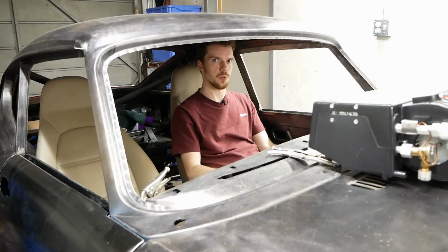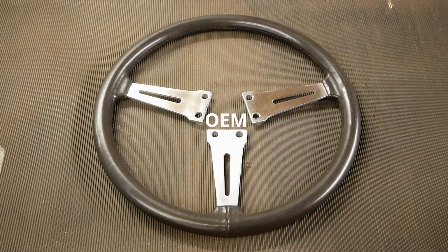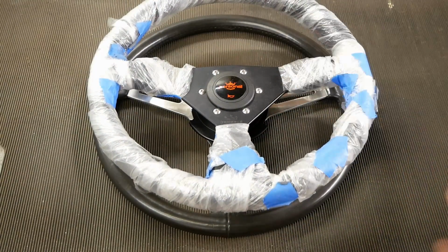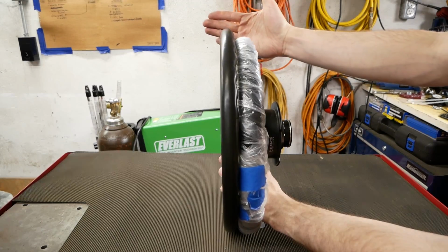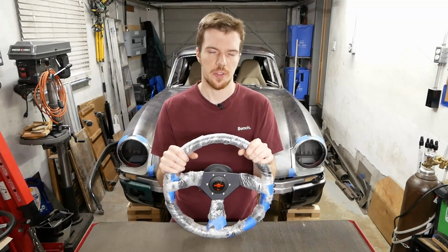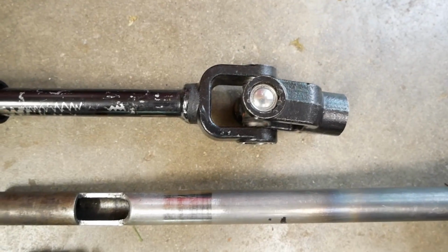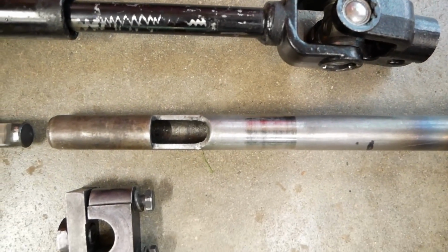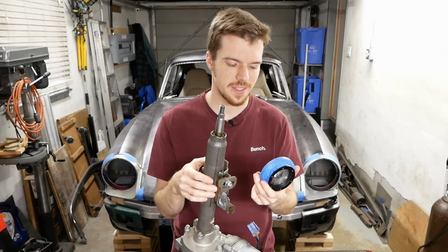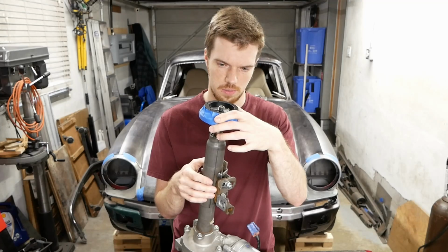Anyway, next up, we need a wheel. And as alluded to a moment ago, the power assist should make things easy to handle, so we can go slightly smaller than the factory piece. This one's actually from my old STI, and it might just be a placeholder, but if not, it's nothing personal. Oh, brother. Obviously, we have to adapt the wheel to the column and the column to the rack, so we've gathered some more components that we'll go over in due course. But for instance, I don't think a Subaru hub is going to fit an Equinox spindle.